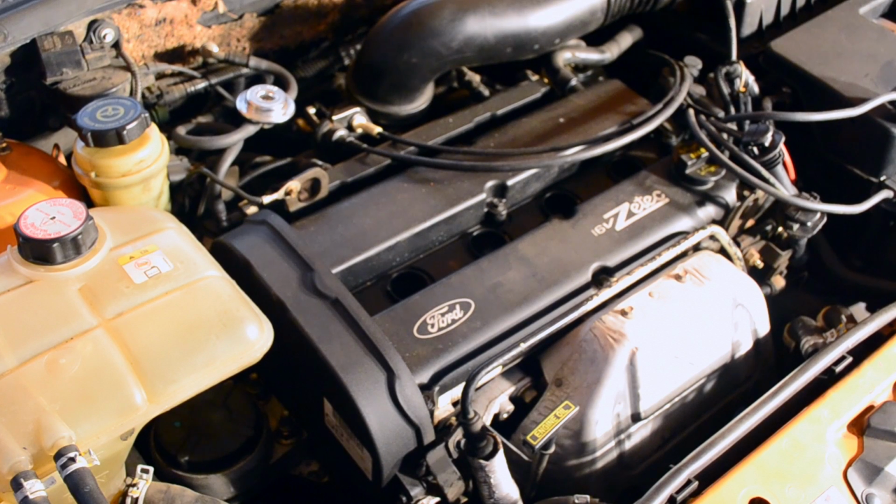In most cases, when you pull the spark plug wires out and look down at the spark plug, you will see oil on the spark plug from leaking inside the valve cover. I will show you a picture down inside of what you will actually see following this.